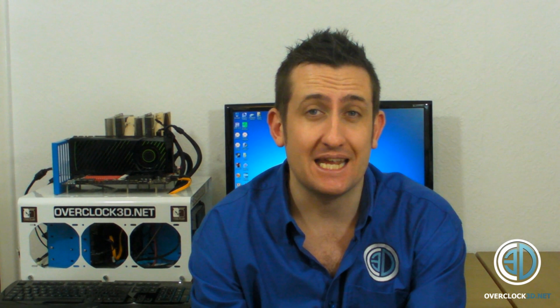You would have seen in one of the other videos, or you can go and see it if you want, already on an Intel board I'm getting 5.1 on this, and I've benched at 5 GHz without too many problems. Heat was in the 70s with a 1.5 plus volt overclock, or 1.5 volt plus V-core, but as I said, it was 5 gigahertz, and it was bench stable at that as well.